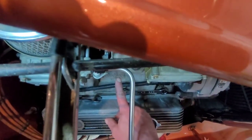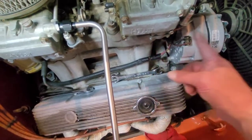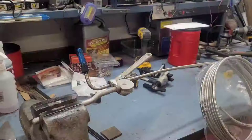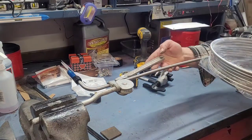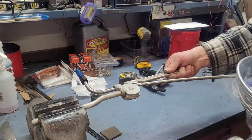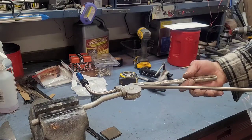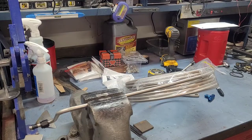This should allow me to go kind of straight down right through that tunnel ram and put the T right up under here, then come up with a nice bend on that side. I made a mark for how deep I wanted to be - there's a zero on this bender. We can start out with that and get the bend lined up. I bought 25 feet of line on purpose so it can be nice and long and have enough for mistakes and that sort of thing. I'm going to use my air saw to cut the line where I want it. This will be long until I figure out where I want it - make sure you get all the debris out of there.